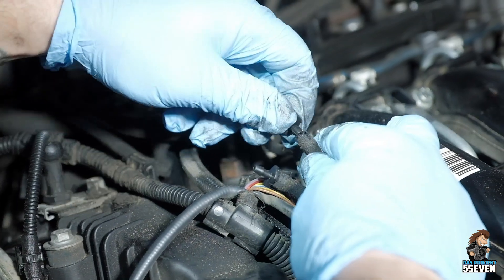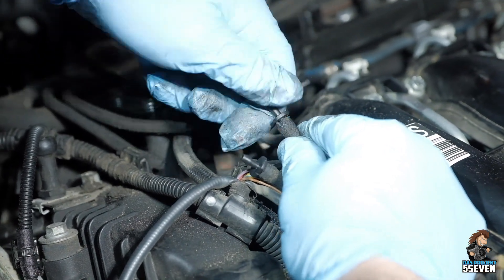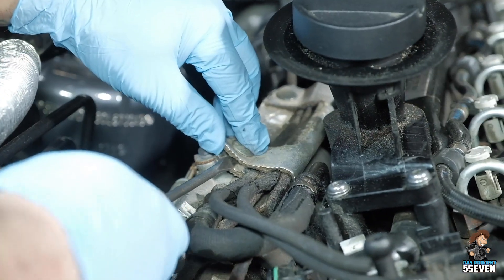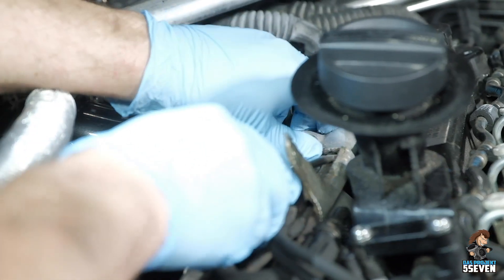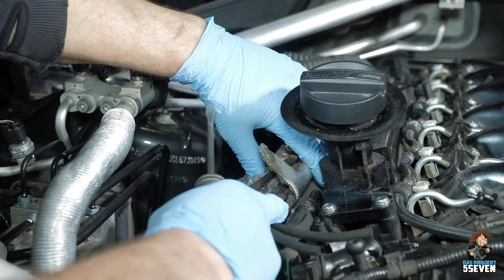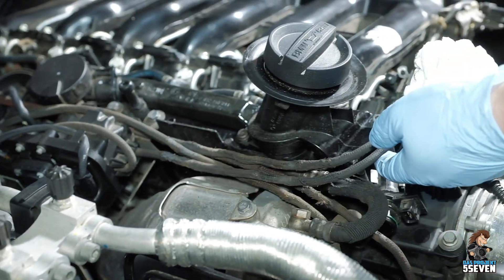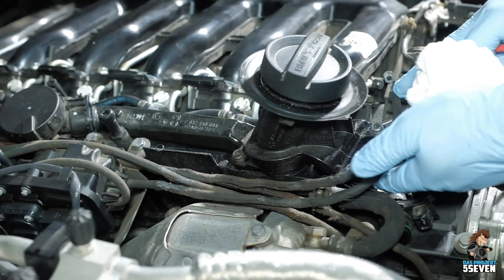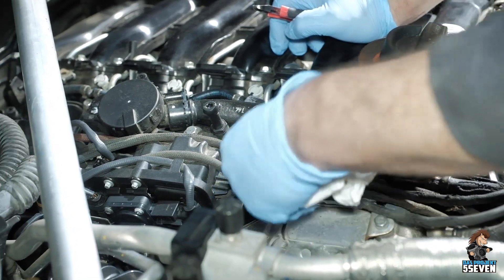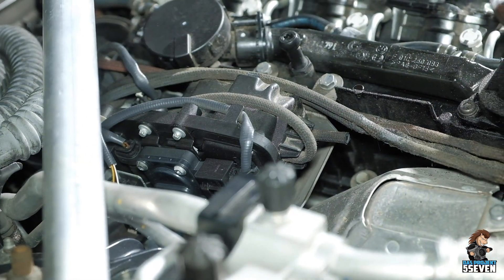Just using these splicers. These lines are extremely dirty - it's horrible, so it'd be nice to get them all changed. I'm going to undo this little sleeve, go from the middle with a screwdriver, and then undo these buttons - this way you don't damage it. We're going to cut more lines here. These are the two feed lines from the central vacuum point, and one of them is coming to the accumulator box, so we're going to cut it here - that frees up some space.